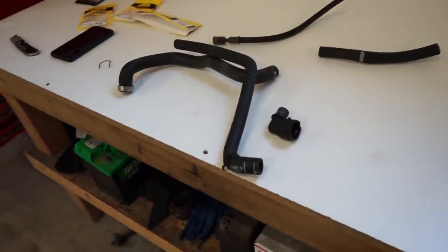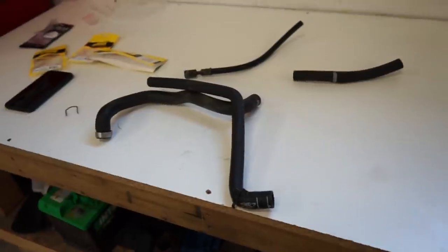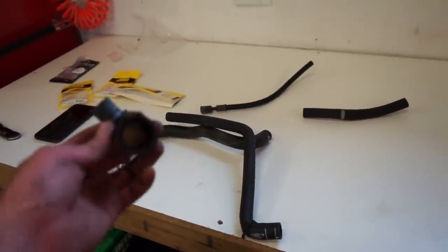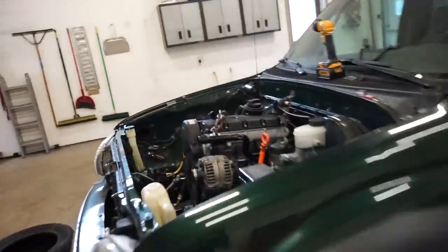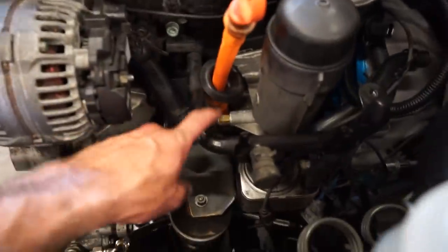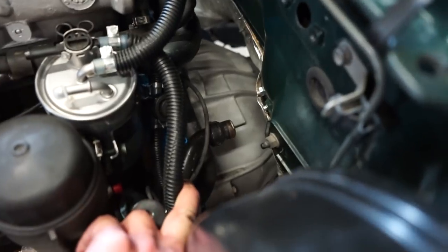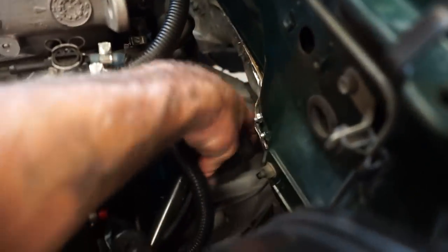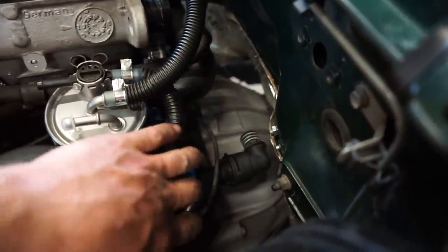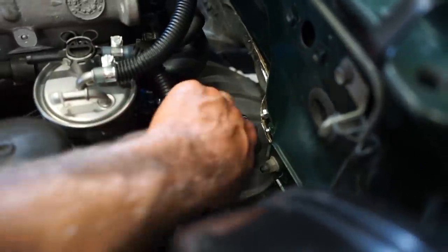Guys, you gotta check this out. So I'm working on one of the heater core lines. I'm just kind of screwing around, seeing what I have and what I can make work. So I found this fitting. This is off the BHW factory fitting, and the hose I'm working on is this one here. So I kept this factory hard pipe that goes all the way back to there. Yeah, it looks like it's pretty close. This fitting does fit, no problem, right back. It still needs to be pushed down a little bit, but it's a nice tight O-ring fit. So that fits just like that.